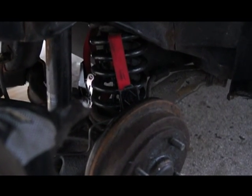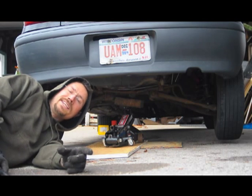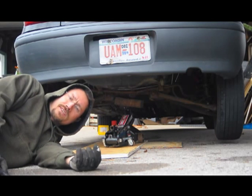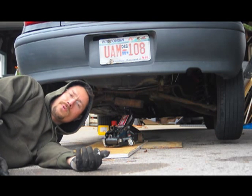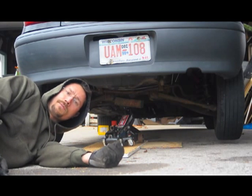Hopefully this should all work pretty good. I just finished installing cut-down Ford Ranger springs in place of my original GeoMetro springs to be able to support the weight of 12 12-volt batteries for a 144-volt electric system in this car. It's not going to use gas, it's just going to use electricity from batteries.